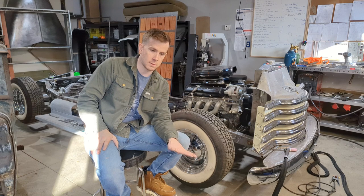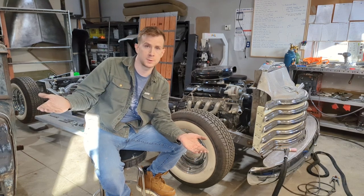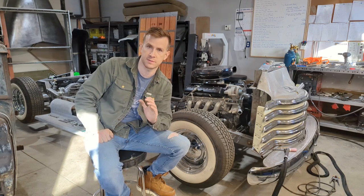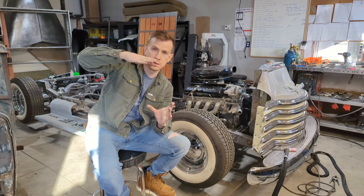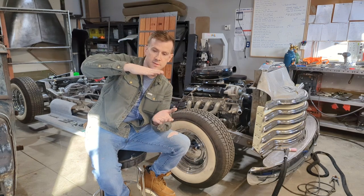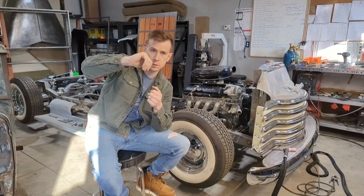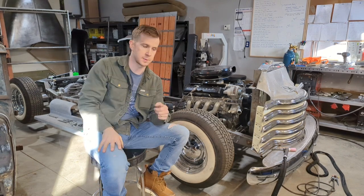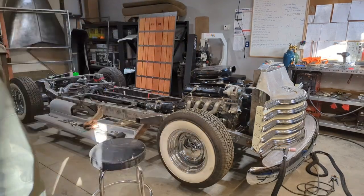If you can drop your scrub line below the control arm when you step it, all the power to you. I didn't want to change the steel wheels that are on my car, so I left the 15s. 15-inch wheels from the center of the spindle, 15 divided by 2, 7.5. So I was only able to drop the control arm 7.5 inches from the center of the spindle. Don't do it. Thanks.